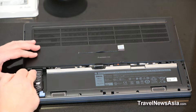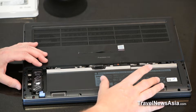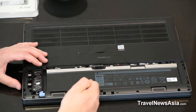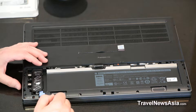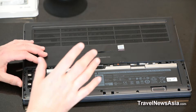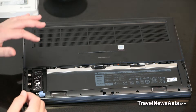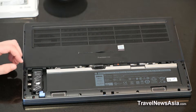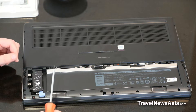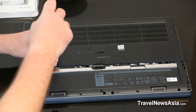Already in this system, you can see that you have one area here which is for an M.2 NVMe PCIe SSD. If you take the smaller four-cell battery, there's actually a slot for a 2.5-inch hard drive which you could also choose as an option. However, in my humble opinion, you're much better off going with the larger battery, and then you can install one, two, three, four M.2 NVMe PCIe cards which are much quieter, faster, and obviously better future-proofing for the laptop. So let's get these undone and have a look at changing the RAM and the SSD.